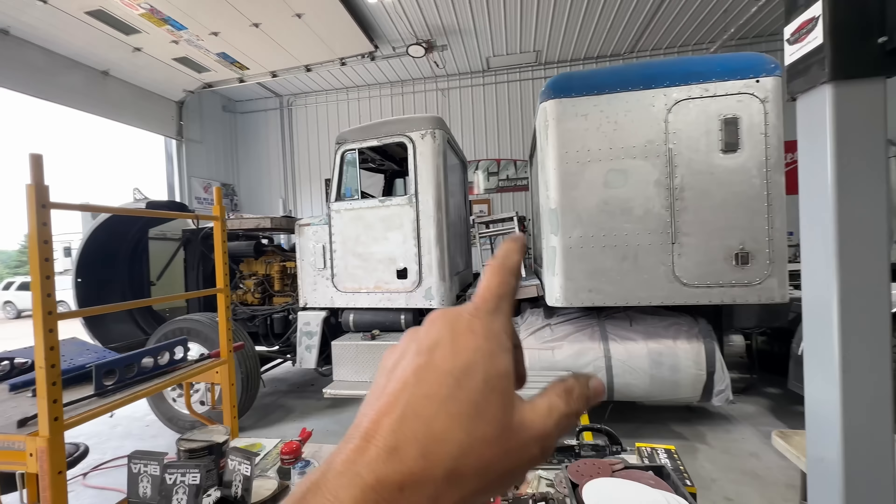After the primer, I want to sand it down with some 320, then some 600. Once it's in primer and that hardens, I'll go over the whole truck with 600, get it ultra flat, just kind of prep myself for as much success as possible and the best paint job I can accomplish. Then I've got to start on the base clear. If this works, I'd do two or three coats, maybe even four coats of base. Then I'd have to let that dry and then do the clear.